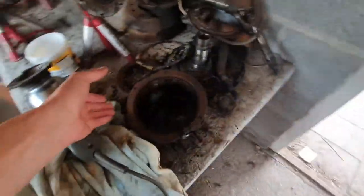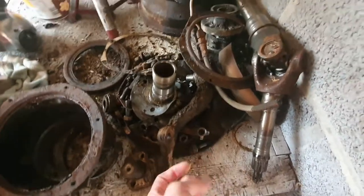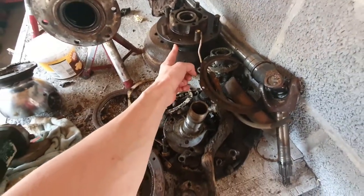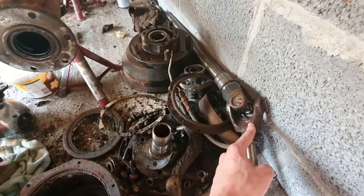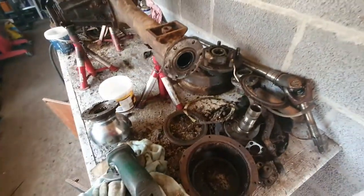All stripped. There are so many parts in this thing. I've come to the point now where I'm going to clean bits up — this large bucket-shaped thingamajig, the stub axle, the back plate. I'll be reusing the drums — they're in spec — and the hubs. And on this side I'm also going to clean that up, it's a bit crusty. The rest of this is being renewed, which is lovely — new seals and bearings where they're needed.